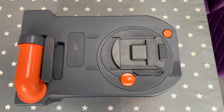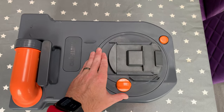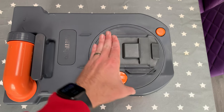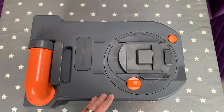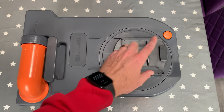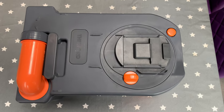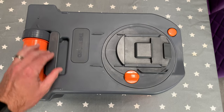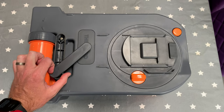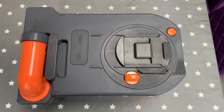The cassette is back together and the float is back in — just make sure it still goes up and down with your fingers. Lock it back into place, making sure you've got the triangle lined up before pushing it down and putting the panel back. For anyone new to caravanning, the button is the pressure release — when emptying the toilet, push it in to allow the contents to flow out more easily. If you've got a wobbly handle, prise it open and you'll find two screws you can tighten back up.